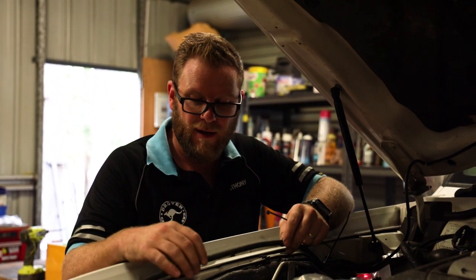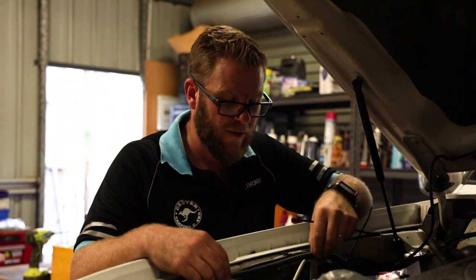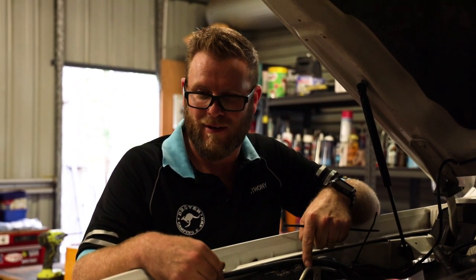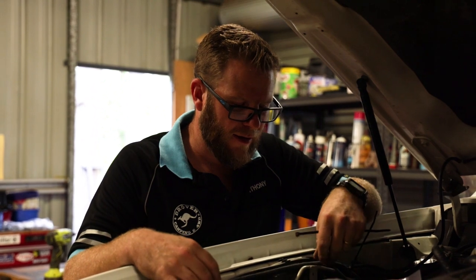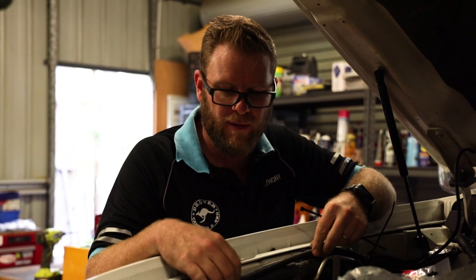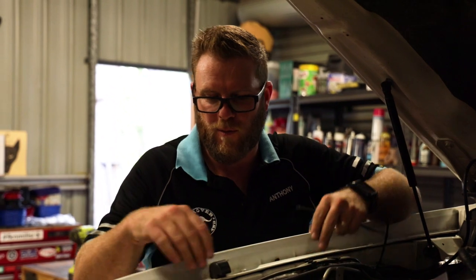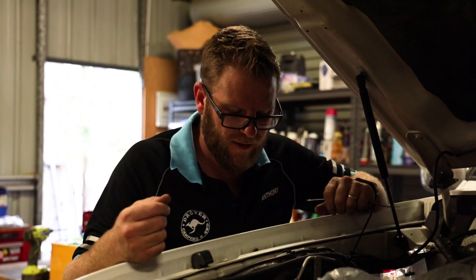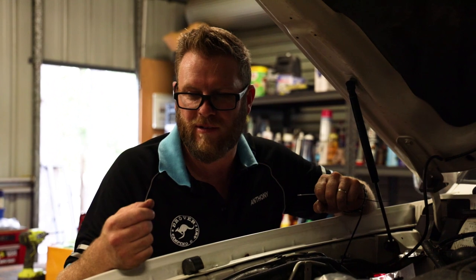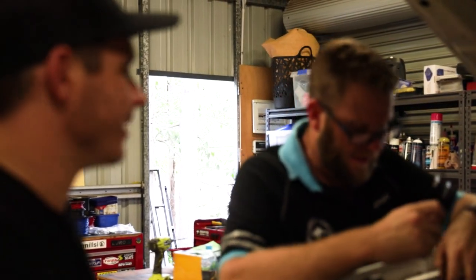This conduit is very hard plastic, designed that way to protect the wiring inside it. Aluminium air conditioning pipes like this one — if you have wiring dangling and rubbing on there and you go on corrugated roads, it will actually rub a hole in the aluminium. I've seen that happen. So stay away from things it can potentially rub on, make sure it's always tied up well, and follow along the factory wiring — it'll end up nice and neat. More zip ties are probably better than less.